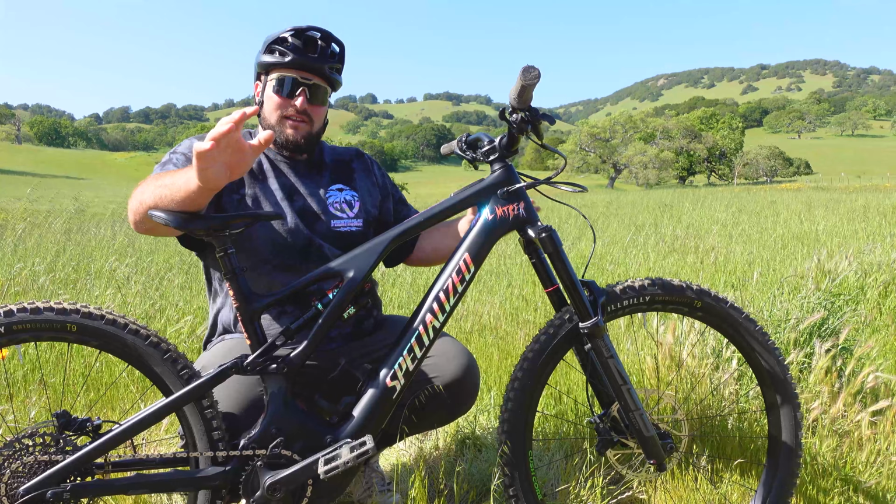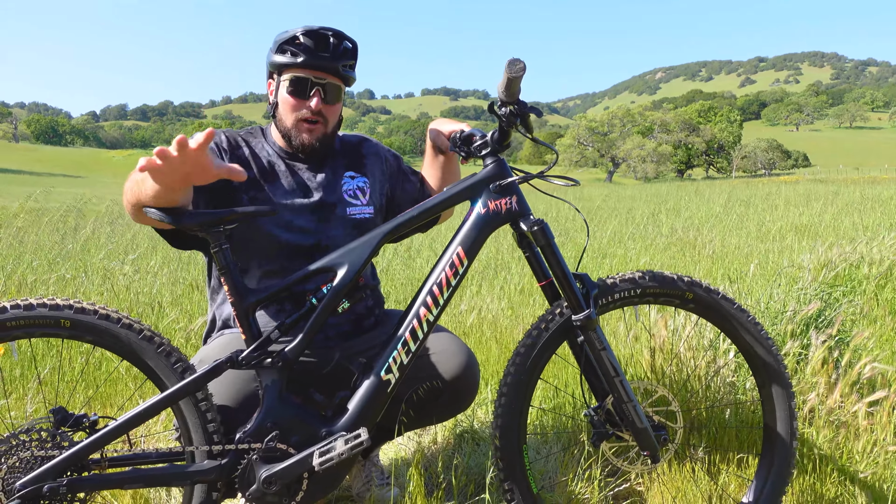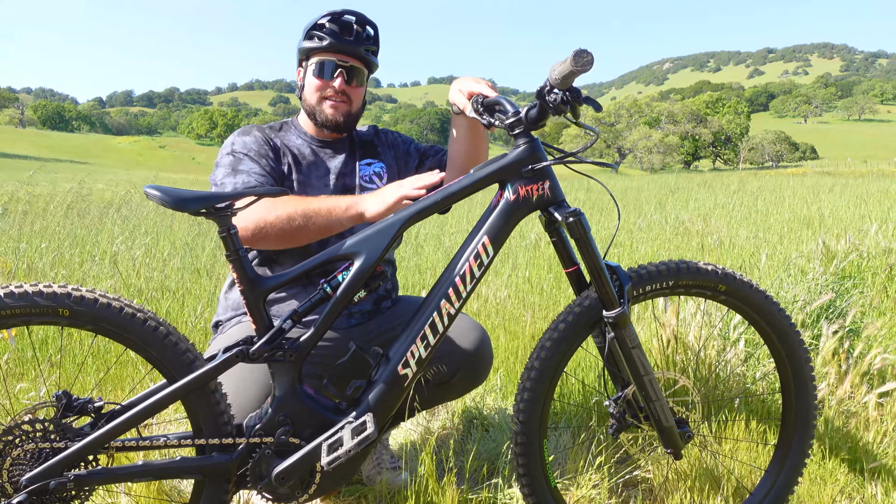because a lot of the trails out in TDS are very, very gnarly, and you guys will see that in one of the upcoming videos because I will film that whole race experience. You guys will see it. The trails are very gnarly, so I decided, why not put a bigger fork up front, a lot stiffer, able to handle a lot more abuse, I guess you could say, and also kind of slacken the bike a little bit. I don't know entirely if the bike's able to use a 170 up front, but there are a lot of people on forums that I read that have done this exact setup, so they haven't had problems, so hopefully I don't have any problems. But already it feels a lot slacker, it feels a lot more capable, so that's a good thing up front.